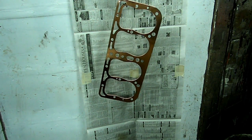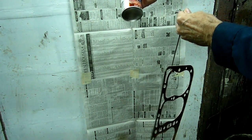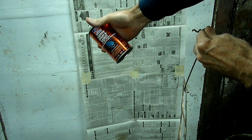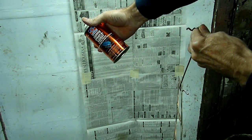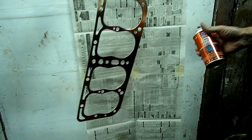So I think we're going to have to have some reconditioning done on this head. It is now Monday and we picked up our new head gasket. We're going to use some Permatex copper spray gasket on it. You can use aluminum paint too, if you want.